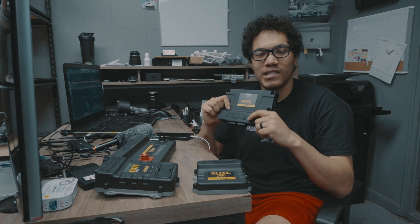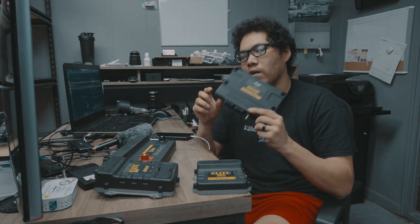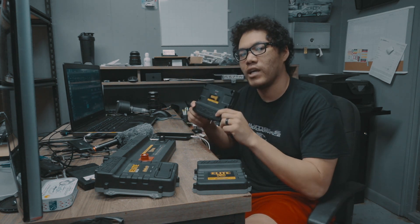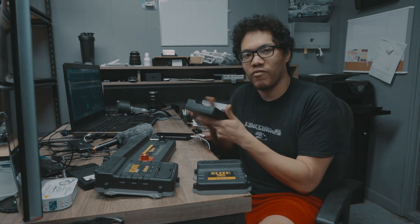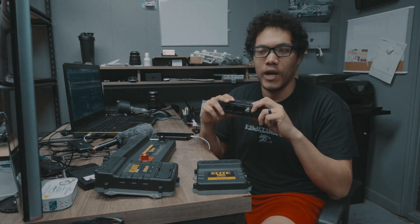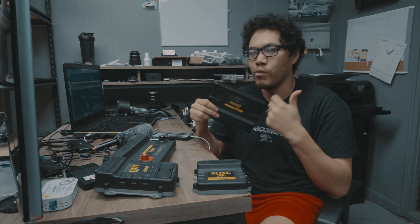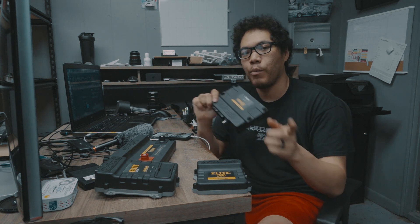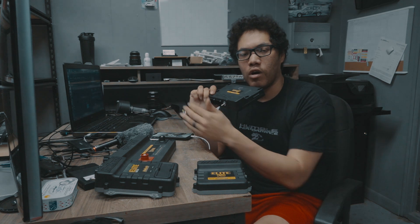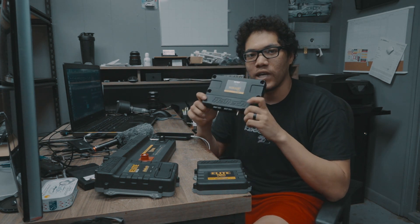I also have the ability to wirelessly tune the car on my laptop without plugging in. Another cool benefit is that you can plug into the ECU via USB and it can power the ECU enough to change maps around. On the 550, 750, and Elite 1500/2500, to access the map you had to turn the key on to power the ECU. With the Nexus, you can do this without powering on the ECU — meaning you can put the map on the ECU without it being in the car. With Wi-Fi, if I'm running multiple customer cars at a track, I can adjust each car wirelessly from the trailer.